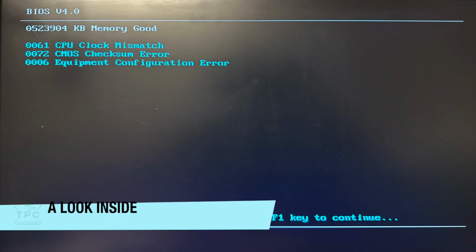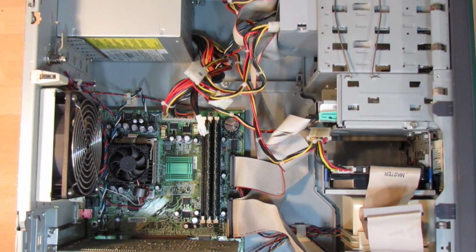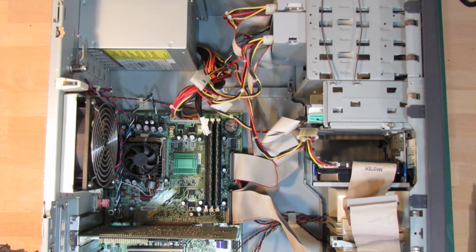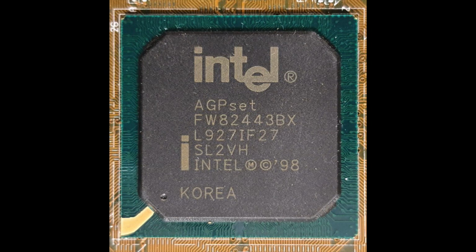So with the error message seen before, it's pretty much clear we have a worn down CMOS battery here. The mainboard comes with the VIA Apollo Pro 133A chipset and is a pretty much standard PC mainboard, featuring both onboard Ethernet and audio options. Important to note, however, is that the Apollo Pro 133A chipset was the most successful VIA chipset at the time, closing in and offering on-par performance in comparison to the then still popular Intel 440BX chipset.